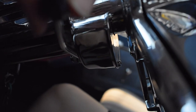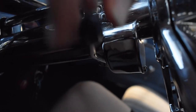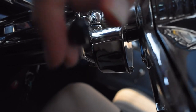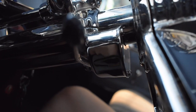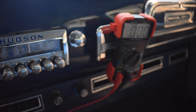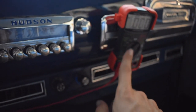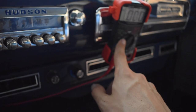Obviously your brake lights are what flash when you move the flashers, so the reason it wasn't failing in the driveway is because I was only testing brake lights and courtesy lights — I wasn't moving the turn signal stalk. I can't get it to fail reliably, but occasionally I can get it to spark, and that's how I knew what to fix. This tech tip worked really well — I figured it out a lot faster than without the ammeter, since I'd been chasing this for months. It would be fine for months, then blow a fuse, and I'd be driving with no taillights and no courtesy lights.